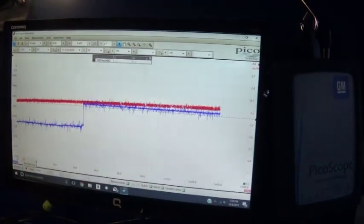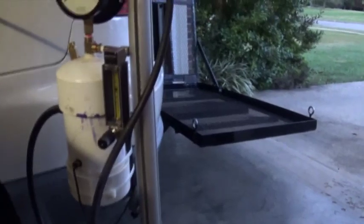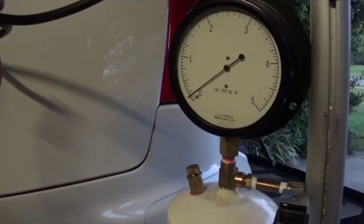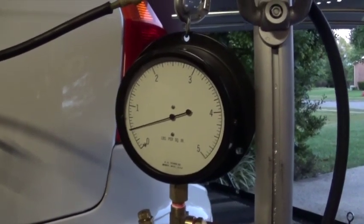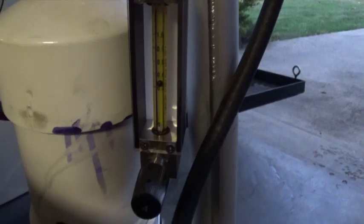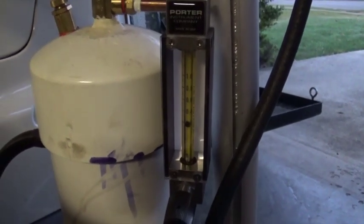So you can see it's losing pretty fast. Let me get my setup and it will start doing this. I got my smoke machine hooked up to the air right now. So I'm just going to pinch the line and set the pressure. I'll make sure it's below 1 psi. That is my float here. Make sure my machine is sealed.